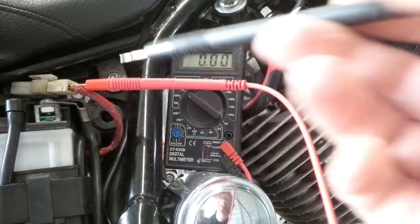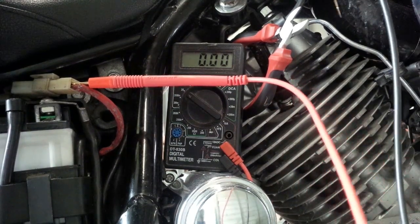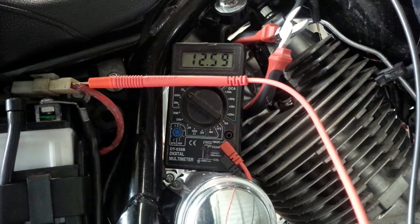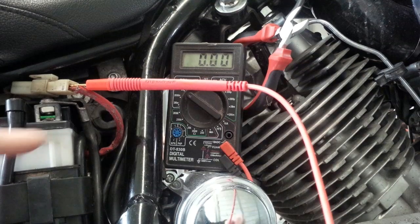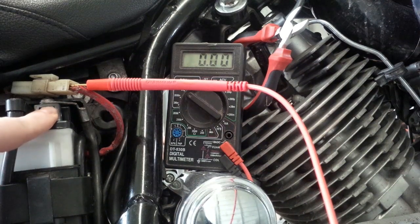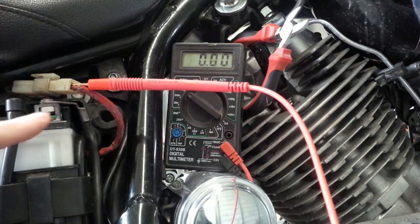The grounding cable is detached from the battery and I'm going to touch the top of the cylinder with it while cranking, to see if the 10.5-volt reading we saw measured directly on the battery gets any lower. In my case there's no difference — that's because my grounding is good, my cable is good, I cleaned it earlier this year, and the eyelets are cleaned so there's a good metal-to-metal contact. If you see a much lower number, you have to check that grounding connection.